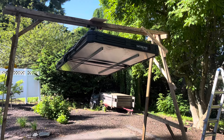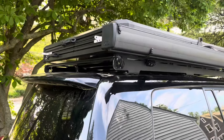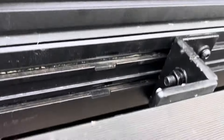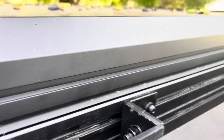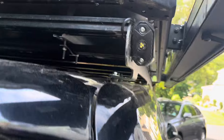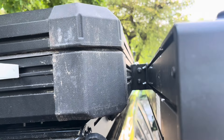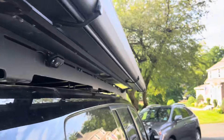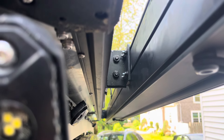Time to get the Land Cruiser under here. This is revision two of hanging the awning. Initially I used L-brackets attached to the 8020. Now I'm attaching right to the channel of the tent. I purchased an angle bracket, two inches by 13 inches, and cut a bunch of pieces — two inches by three and a quarter inches high.